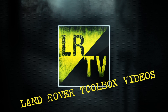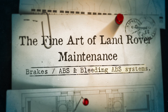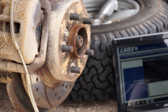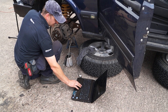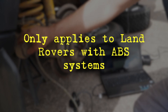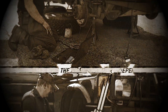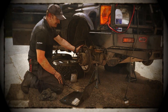Hello guys and girls, welcome back once again to the Land Rover Toolbox videos — the fine art of Land Rover maintenance. In this video we're going to show you about power bleeding brakes with the assistance of a computer or interface to set off your modulator so you can bleed brakes correctly. This applies to ABS systems only, however it is fairly standard practice with hydraulic brakes these days to use an interface device and activate the ABS modulator to bleed your brakes.